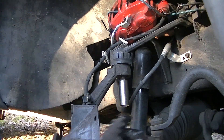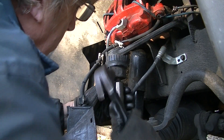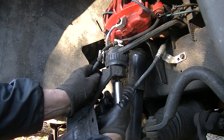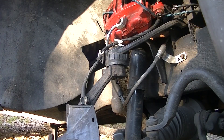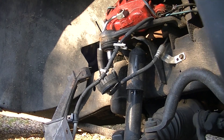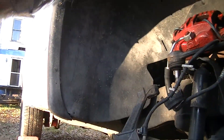There's our nut. Try to take your socket off before you pull the nut off — it makes it a little bit easier sometimes. Now all we've got to do is take our hammer and sometimes just hit the side of this and boom, it comes off. Just a little bit of hitting sometimes does wonders. Now I'm going to set the camera back so you can watch me pull the axle out.